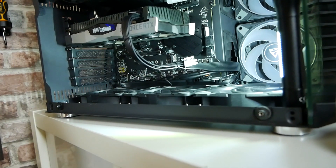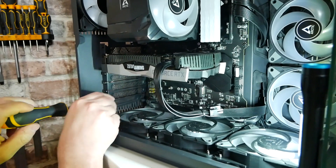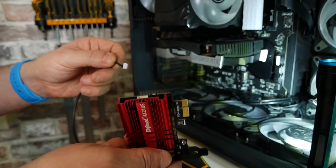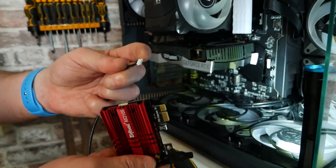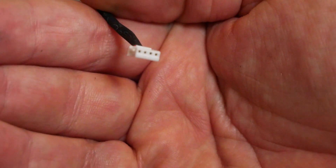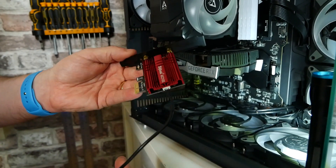Try and use one lower down on the motherboard to give you a bit more room to work with. We're going to remove the corresponding PCI Express blanking plate using a cross-headed screwdriver. Next we need to plug in the USB cable. Because of where it is in the PC, it's probably easier to do this before you actually install it. The little lugs on the end should match up with the lugs on the card — the lugs should be towards the top of the card. Push it in and give it a little wiggle until it's firmly seated.